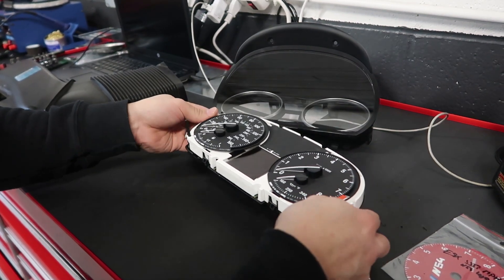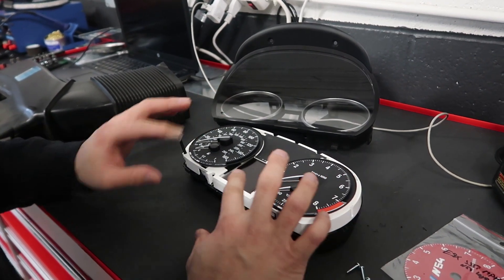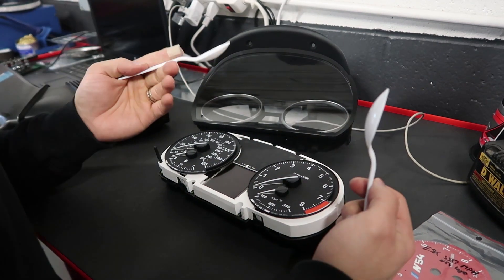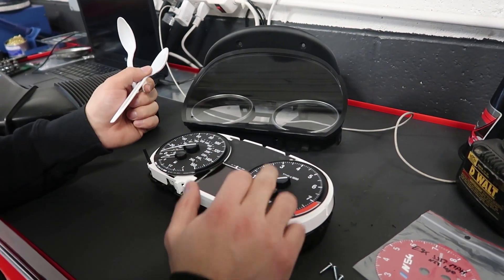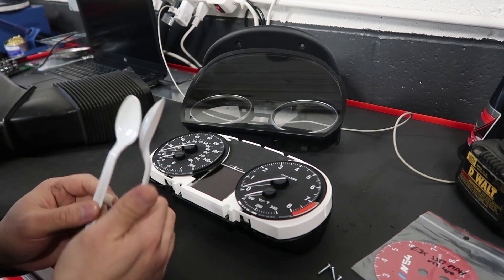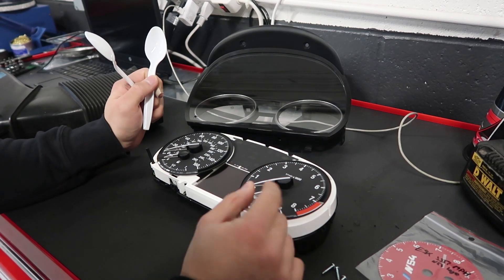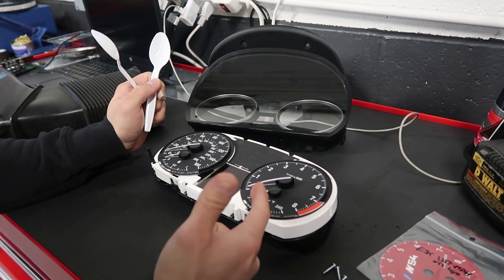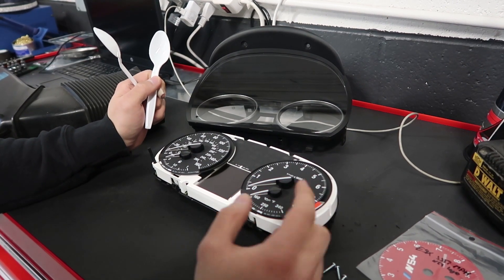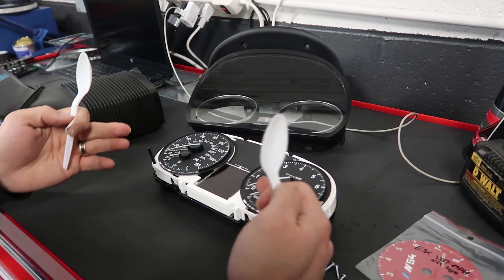You are now exposed with just the cluster. Be careful because the unit will come out from the bottom, so we want to keep it all together. Try not to tamper with too much here. With some spoons — I prefer metal spoons but we're using plastic ones — we're gonna take off each of the needles. Just make sure they don't break or bend. The key is to carefully lift these dials straight up without turning, torquing them, or going backwards. Start with the big ones and move to the small ones.